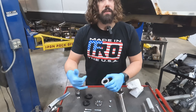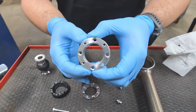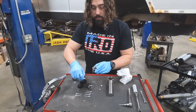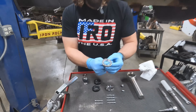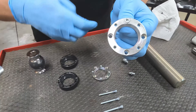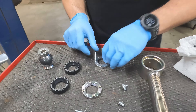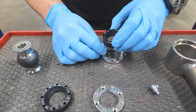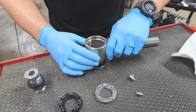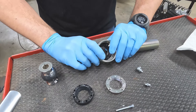What's going to be a little bit different about this one is we are sending bolts through, but it's going into a threaded collar — we are not going to have nuts on the back side, so it's a little bit simpler. You can see it's an alternating pattern: threaded, threaded, threaded, and then a recessed hole where that socket head screw is going to sit right into. So we'll get a couple started, flip that over, put a race on, and get that into the male end. It's a bit of a tight fit, but it goes in nice.